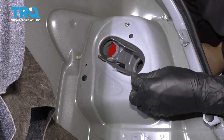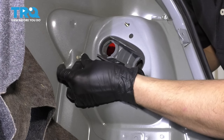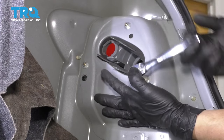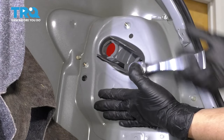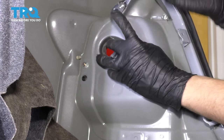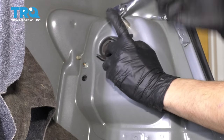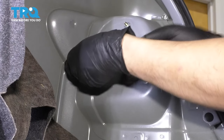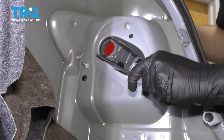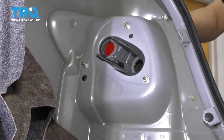Let's put the three mounting nuts on and then we'll tighten them up. Snug them up just enough to pull the taillight in and press it up against the body — that's what's going to create a nice watertight seal, otherwise water can get into your trunk. Make sure these are all approximately the same tightness. As you tighten the last couple, the first one will loosen up.